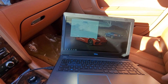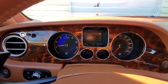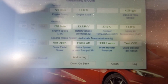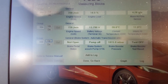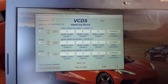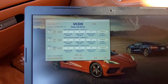Back with the laptop hooked up, the repairs made, and the codes cleared — it's time to see if our repairs made a difference. She's running smooth, we don't have any lights. The numbers look really good: the mass airflow sensor voltage, cooling temperature sensor, and air intake temperature sensor all look good. We had a mass airflow sensor fault and an intake temperature sensor fault before — both look good now. The brake booster pressure is reading pressure too, so maybe we've helped fix that problem as well. We have no misfires on cylinders one through nine, and no misfires on ten through twelve — that's a really good sign.